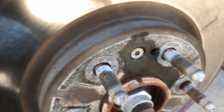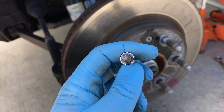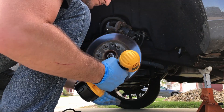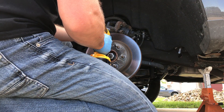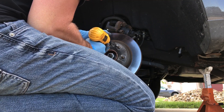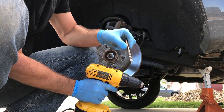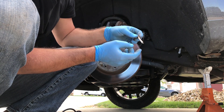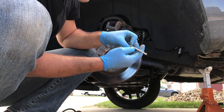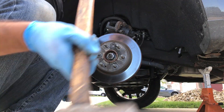I pre-soaked the screw, but that really does nothing. My Torx just totally stripped it out — it's one big hole now. So now I'm just going to drill it out of there. The head of it just came off, kind of like a pop rivet — that was using a 5/16th drill bit. Now we can get back to what we were doing after that one-hour charade trying to do this.